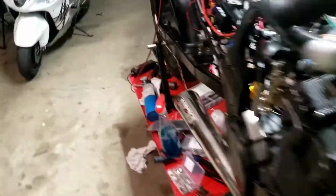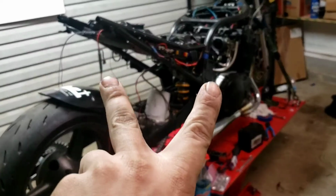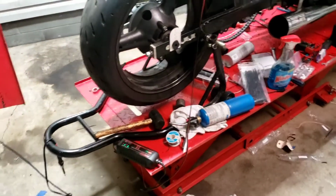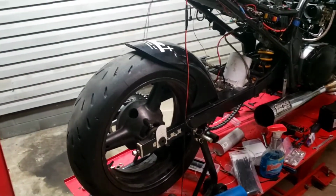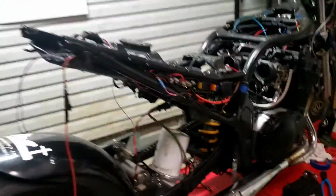Because I did that last night, and trust me, trying to get a lithium-ion battery charger to recognize a dead lithium-ion battery, not so nice. You got to hook it up and then hook 12 volts from a jumper battery through a small gauge wire and just touch positive to positive, negative to negative. And that thing will trigger, hey, I need a charge, and it'll start charging. From there, you just ignore it and it will come back to life. It took overnight, but it did come back to life. My battery's full and ready to rock and roll.